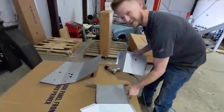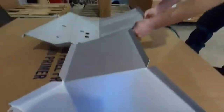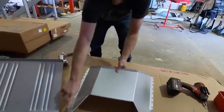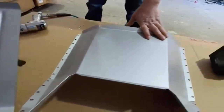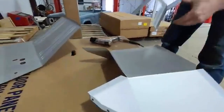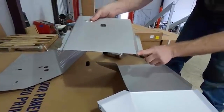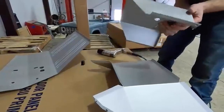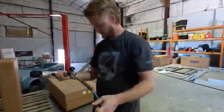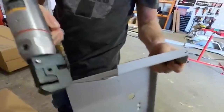We're punching these out for all these pieces. On this other side — the one Jared's been working on — everywhere I'm punching is the firewall side, not the interior side, so we'll do all the welding from that side. On this particular piece it goes like this, so I'm actually going to be punching right through here to weld from the firewall side. Pretty simple: you slide it in, and punch the chunk out.